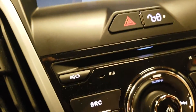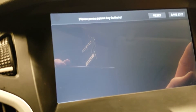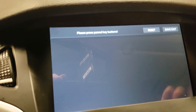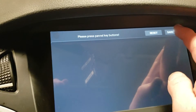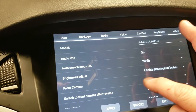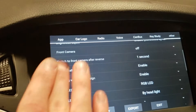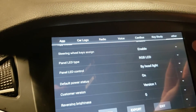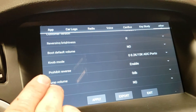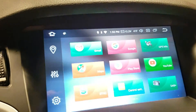Under Key Study, you can change what all of these buttons do. There's also Panel Key Study — hit the nav button, it'll bring up the different options. Under Other Settings, you can change the brightness, control whether the button lights come on with the headlights or are on all the time. They have it listed as RGB — it's not. Really don't want to mess around in here too much. That's basically it for the software review.